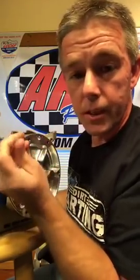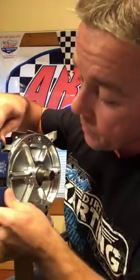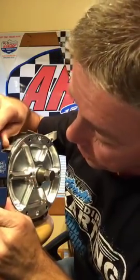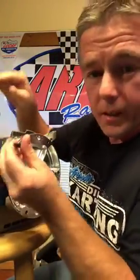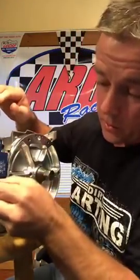You know, the OEM for stockers, we're in the 60 to 70 range. Plates, we're in the 70 to 80 range. This one, you're typically going to run around 40 to 45 thousandths all the time. That's pretty much all you're going to need with this, because if you get outside of that, I've noticed a little bit of inconsistency when you get up to around the 60, 70 mark. So typically, you're going to run 40 to 45 thousandths. That's all you need. And I'm not going to feeler gauge this, I told you, so y'all just go with that.